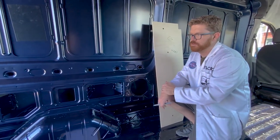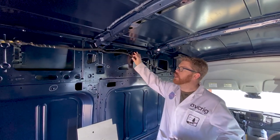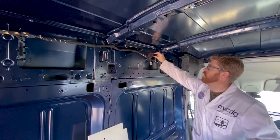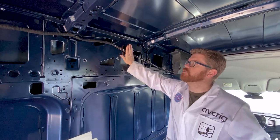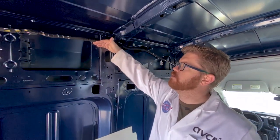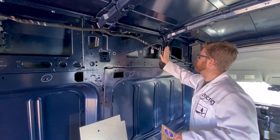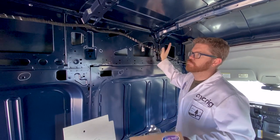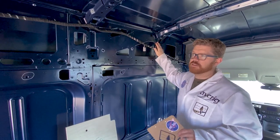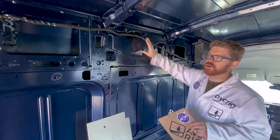Now we need to block this upper wall section to account for the thickness of our wiring harness. What we do here at the shop is add a 1-inch piece of Owens Corning foam — or pink foam — to just space that wall kit out so it's not pressing on the harness itself. We glue in a foam strip right below the level of the harness, all the way down the side of the van. Where the harness dips below, we put the foam up above, so our wall kit fits around that wiring harness without any pressure conflict.